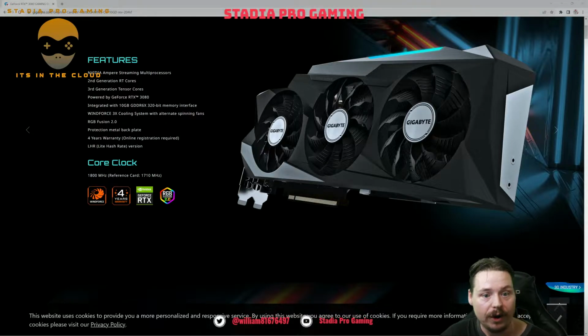So we removed the card, and surprisingly enough, when I bought this CPU, it stated there was no onboard integrated graphics, none of that stuff. You had to have a discrete GPU. Well, I connected the HDMI to the motherboard out after removing the card, and I installed Windows 11 that way, put the card back in, and we were off to the races. Beautiful. Worked great. I installed the 4K capture card. Everything went really well, but not having the card boot up right at the first post test was a little discouraging, but we got it, you know.